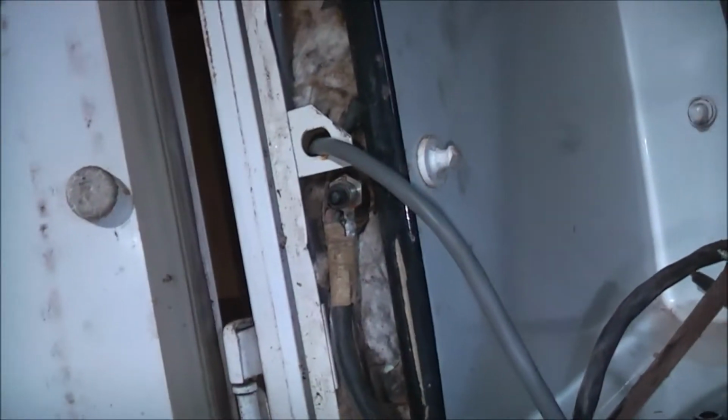That wiring though. That old wiring was a house fire waiting to happen. That is rooted. It's crumbled up and just crumbly. That's all done. Now I've got to just earth it, mount that relay, do the earths, and that underneath the fridge, the compressor housing, that's all done. Then I can move on to this bit. She's good, electrically safe now.